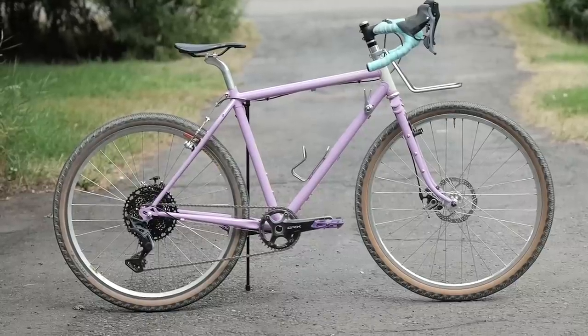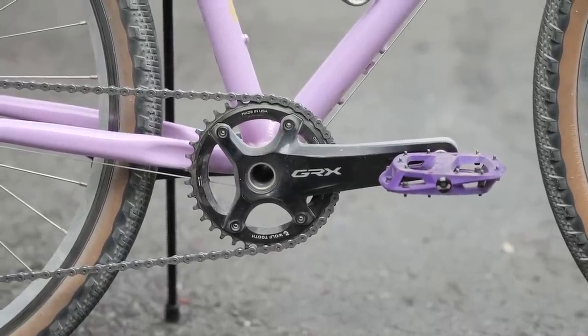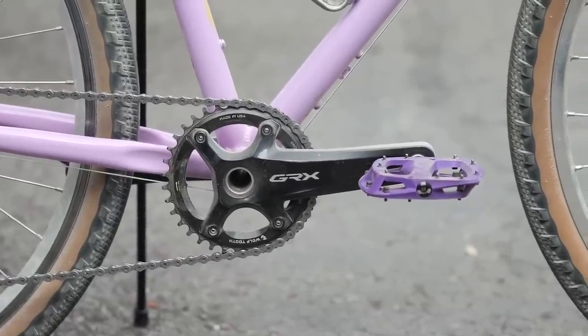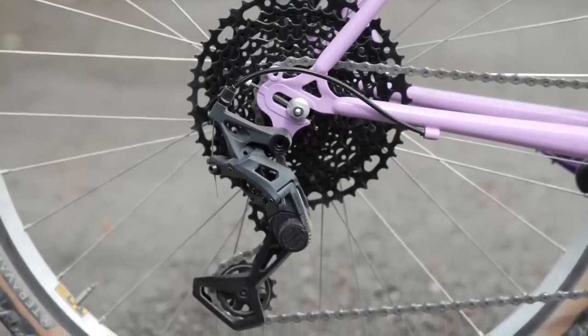Now let's talk about the not-so-good. You'll notice on the Hachita I'm not using the Sword crankset. Personally I think 40 and 42-tooth 1x systems, especially with just an 11x48, is a bit overgeared for bikepacking where there's any climbing and you're actually carrying things. It's probably enough if you're riding unloaded or not in mountainous territory, but I think the gears could have been lower. It's one thing to not have to come out with a giant pie plate of a rear cassette, but they could have offered chainring sizes in the 36 or 38 range to make the most out of that 11x48 cassette.